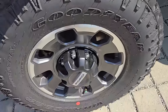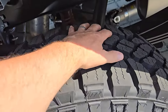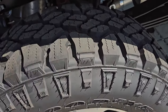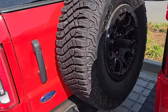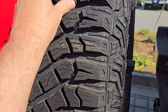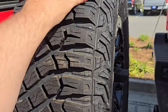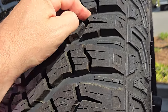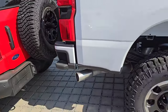Here you have a Goodyear Wrangler Dura-Trac, which is a very aggressive all-terrain. It's got big lugs on the outside and a tighter lug pattern on the inside. These are a harder durometer, so you're going to get more mileage out of these tires. The Maximum Traction is a softer durometer — you can actually feel the movement in these lugs; they twist and turn. Look at how functional that is off-road — how grippy and how well that's going to work.